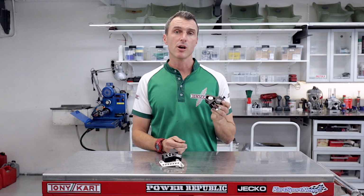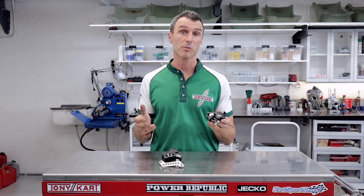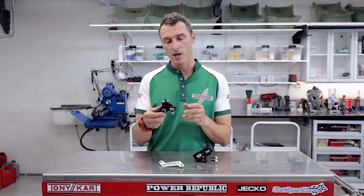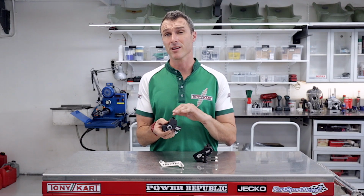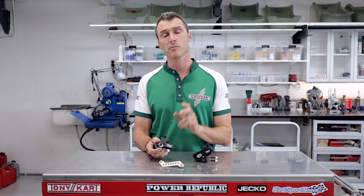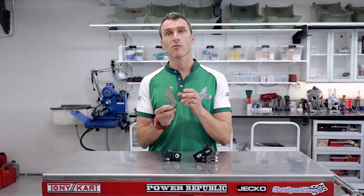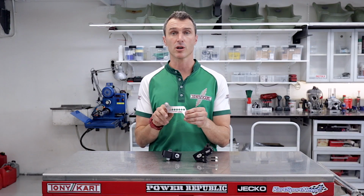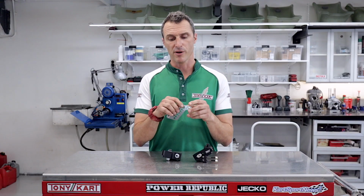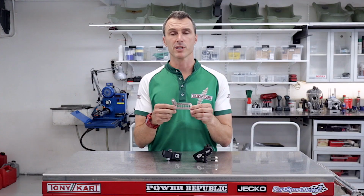So today's video, we're going to be showing you how to fit the V2 adjuster to the Tony Kart Krypton, which is our shop racing kart here for this year. But if you did have another go-kart, you'd be fitting the V1. Now, they do come in 5 models, so go to the Fast Adjusters website to check out the model that you need. Each kit comes with a side plate that can be reversed in orientation because these holes are offset by 5 millimeters if you did want a half a hole adjustment. But for the most part, and with the track testing that's been done already, the 10 millimeter spacing is perfect.